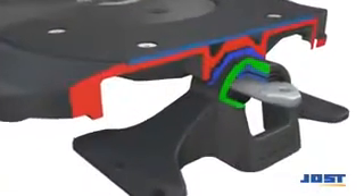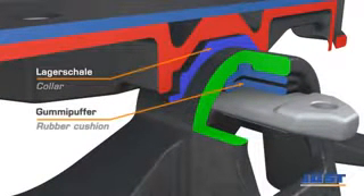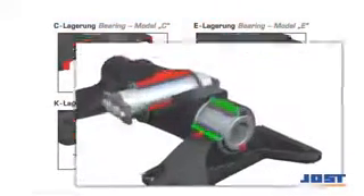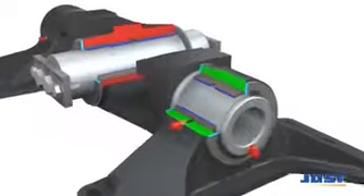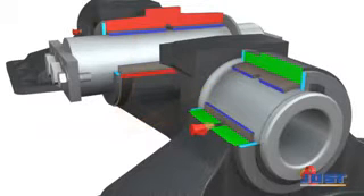The K bearing is designed to provide longitudinal flexibility. This design helps to protect the chassis frame during lateral distortion. The cardan bearing G reduces torsional stresses in the truck chassis in off-road conditions, thanks to its double oscillation.